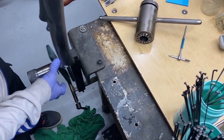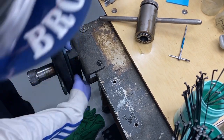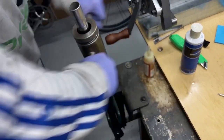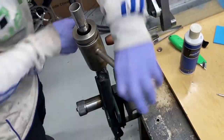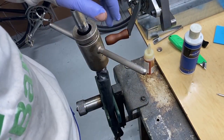This is the tool that we're going to be milling the crown with. This is a Park Tool. We're going to face the crown and mill it from 27.0 to 26.4. This tool has a nice long one inch pilot guide inside it to ensure perpendicularity of the cuts to the axis of the fork.